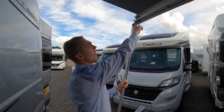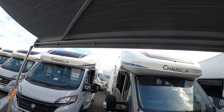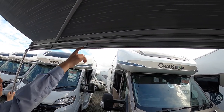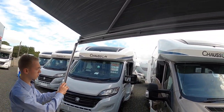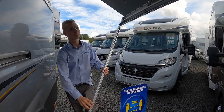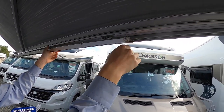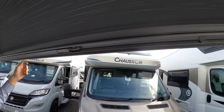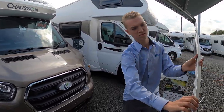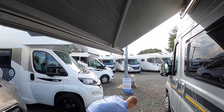Wind and awnings don't mix — they will damage your vehicle or someone else's next to it. Take it in when you go out, when you go to bed, or at any sign of wind. On the front you have your C-rail built in — this is where you attach a drive-away air awning kit for extra room. To put the legs away, just reverse the process: loosen off, hold the leg in, make sure the foot lies flat with the front of the awning, push in and clip in, then you can wind it back in.